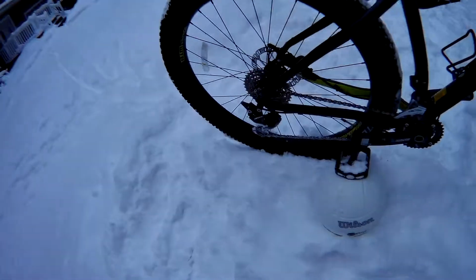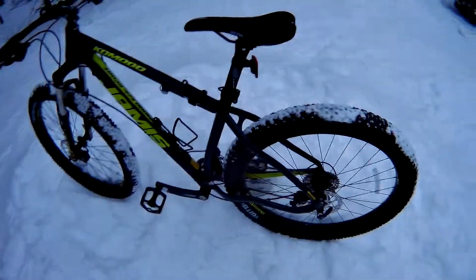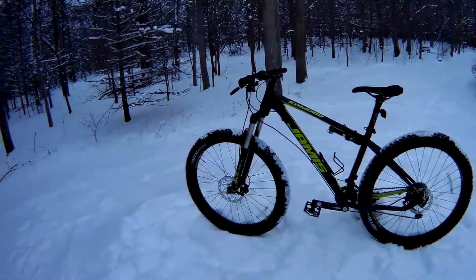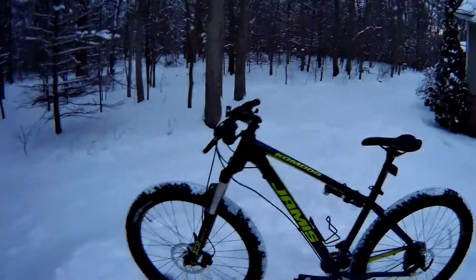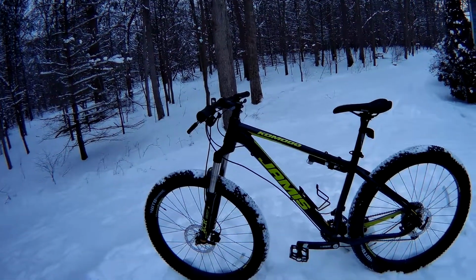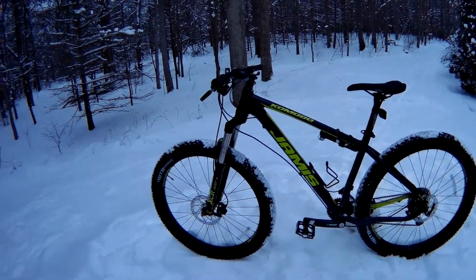And oh yeah, also on the back, we do also have through axles. So basically, those through axles give you a lot more stiffness in the ride, in a good way. So yeah, overall, this is a great bike. It's got modern trail geometry on it, right? It's running a 68-degree head tube angle, which can be steepened or slackened by running more or less travel. More travel making it slacker, less travel making it steeper.